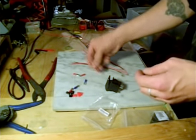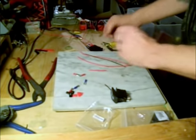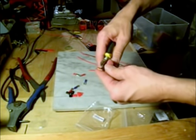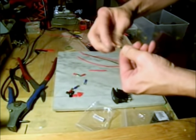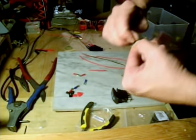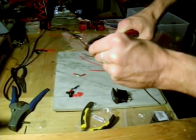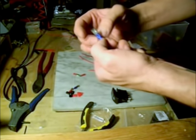You're going to need some short pieces of wire, the spade connectors, heat shrink, and some various tools. We'll start with the black one — just do the ground, make it nice and easy. Strip off a portion of that. Always twist your wires a little bit so that when you put them into the connector they don't fray and leave bare wires sticking out. I also like to make sure my connections are short because you don't really need a lot of extra bared wire — the more you have, the more problems you can have. Get those nicely seated. You're going to do two — a short one and a long one into one of the blue connectors. Make sure you pinch it on the opposite side of the seam that runs down the inside, so you're not splitting the seam.